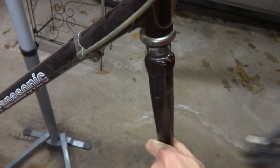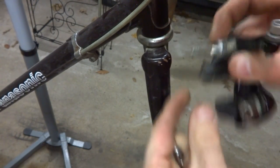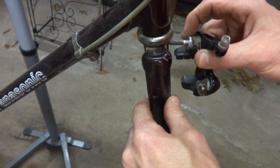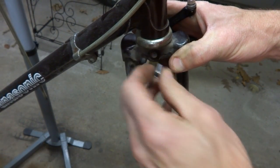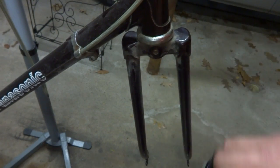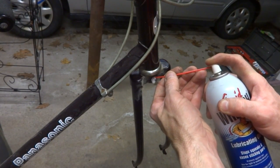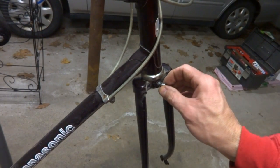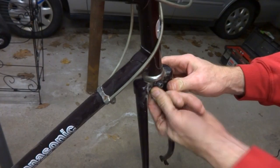For the front fork, you're going to use the brake with the longer bolt, and that'll fit through like that. There's also a concave washer but it's a wider diameter, so that'll fit through like that. Then you're going to want a recessed nut to fit in the back here. Again you're going to have to drill this hole out to eight millimeters or five-sixteenths and ream that out. Then use a little bit of lubricating oil, then test fit the recessed nut and make sure it's going to go in through the hole — and yes, it's going to fit.